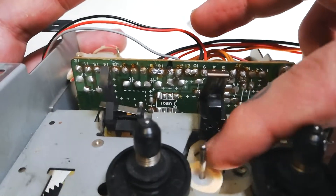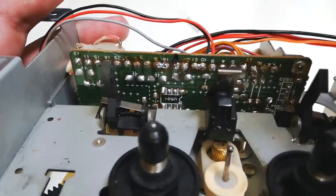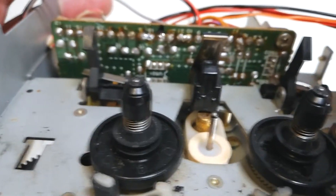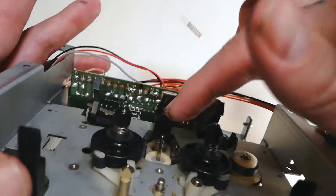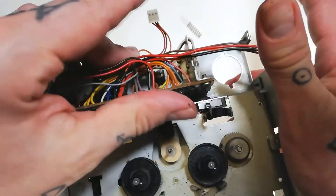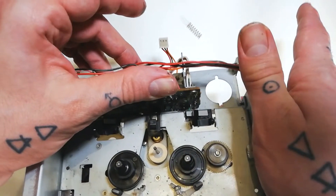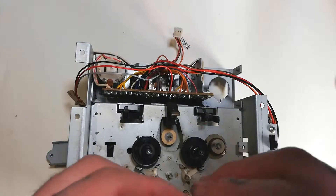Sometimes what you'll get is that the little brass spindle at the top of the idler motor is also covered in gunk, so we need to get in there with an isopropyl-soaked Q-tip and clean it. We have got that muck on there. If you needed to get into that brass bit, it's quite easy to remove that plastic clip — just unscrew one screw and you can put it back in. But we can just clean the surface of that.